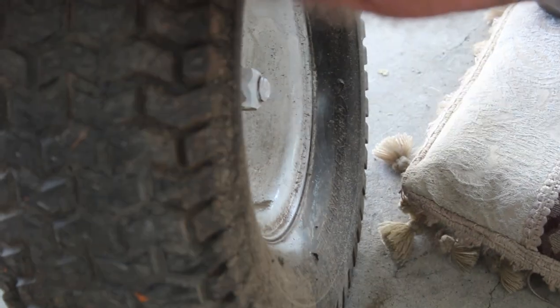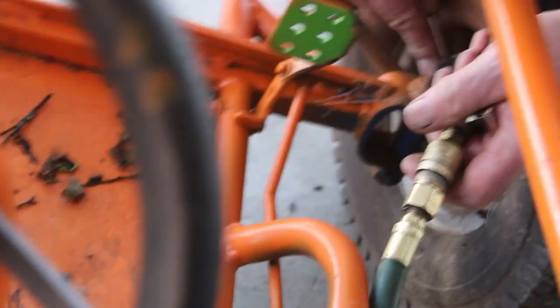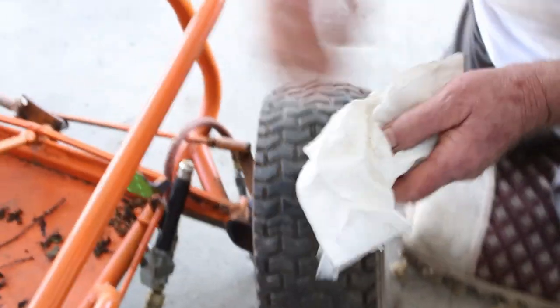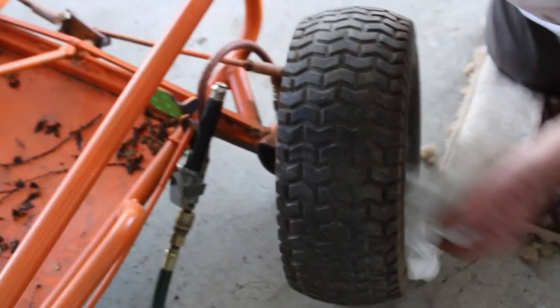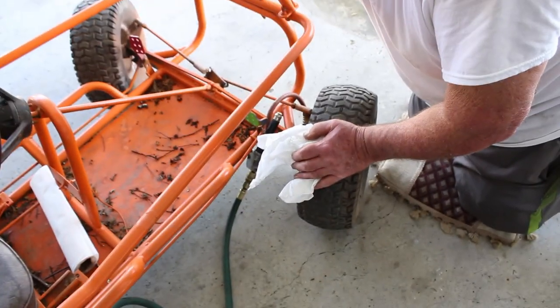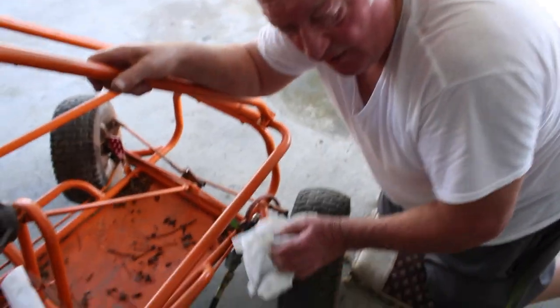We just realized that this tire is actually on backwards, because the stem is on this side. I don't know if you can see it, but this stem is literally on the inside, which is not supposed to be like that. And I totally didn't even notice when I was painting this thing, which is crazy. Always, folks, remember this: the valve stem always goes to the outside. Put the proper amount of air in there, and then you're safe. And always put valve caps on it because it prevents leakage.